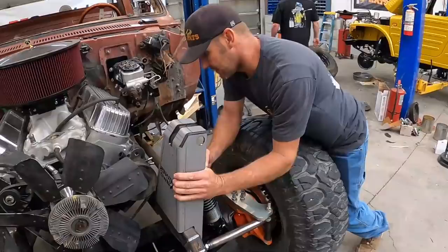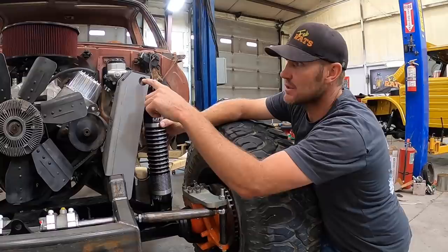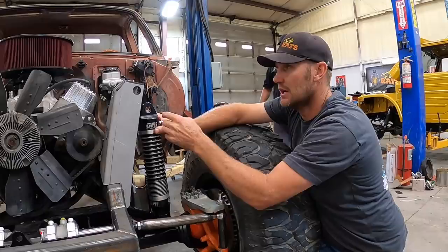They go long bolt — shorten those way down. I don't know how I'll get a bolt in it down there, that's the only problem. Probably going to want that up there — that makes more sense. So that's how it's going to work. I'm going to take a piece of one-inch round stock that's long enough to go through there, drill a hole clear through it, then cut it in half to make my bushings to go in here, weld them in, and put a bolt through it.